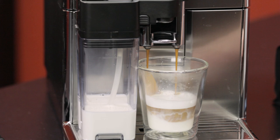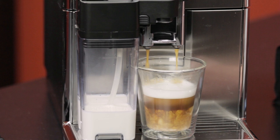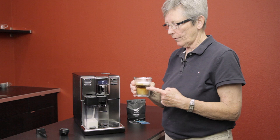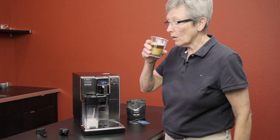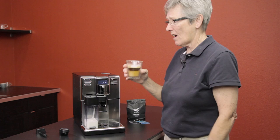If your shots are not coming out right — too fast or too slow — adjust the grinder. When you make an adjustment, you'll need to brew off about four to five shots for the machine to actually reflect that change. The factory settings aren't always right for your particular blend. Look at that nice separation: foam, milk, coffee. The coffee is pretty hot. Preheat the cup ahead of time — that's important. Also preheat the machine a little: go to bypass doser and brew a shot of just water to warm up the brew unit inside.